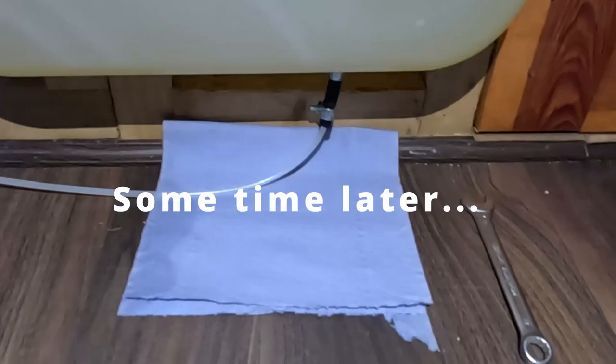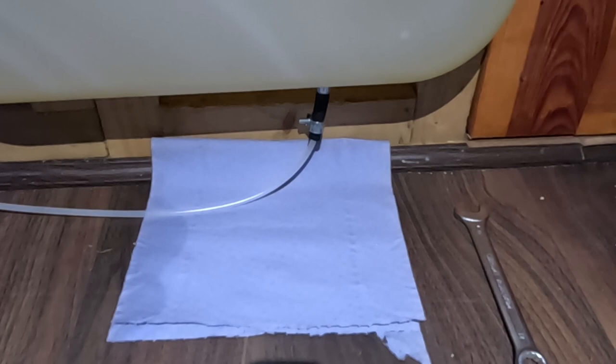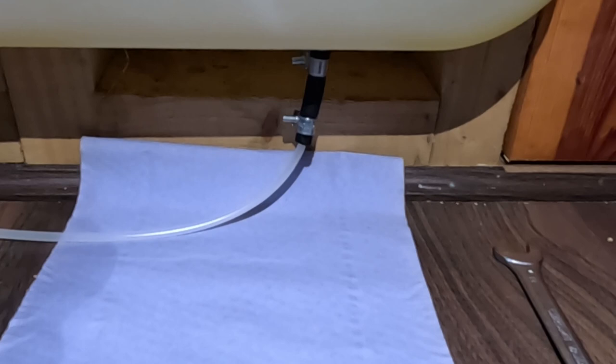It's the next day, light was fading, there's still not much light, it's early. Had a slight leak with the diesel coming out the bottom of the fuel tank. So I've just tightened up the Jubilee clips and also the thread that goes into the fuel tank. And I'm just checking on that. Keep an eye on that.